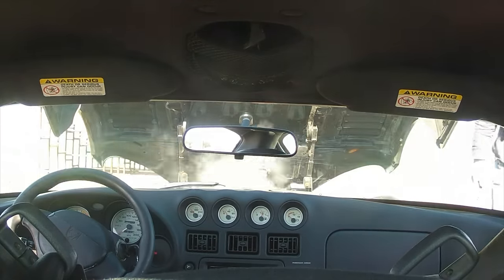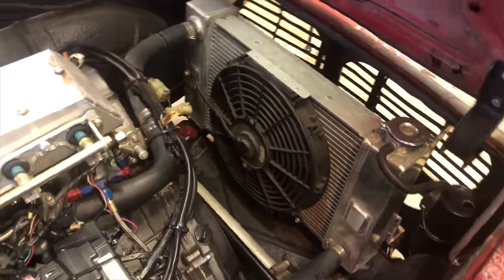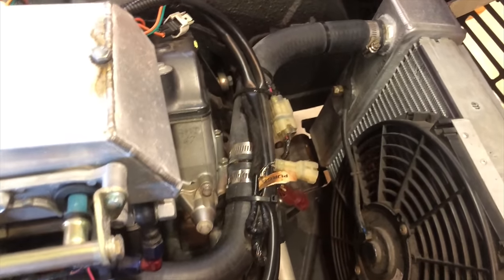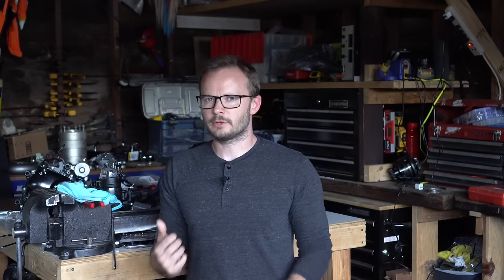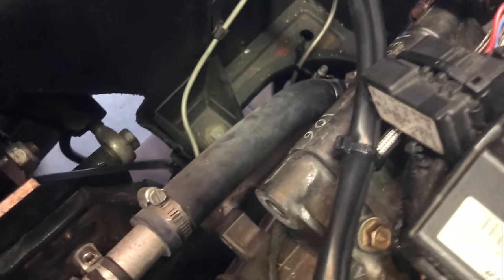For cooling, you can use the radiator that came with the car — super easy — or the radiator from the motorcycle, which is more difficult. I took a third option: I bought the widest radiator that would fit in the car, cut the bottom off, and welded caps on it for maximum height, essentially filling the whole frontal area with a big aluminum radiator. It's more cooling than needed, but that's better than not enough. For plumbing, go to your local auto parts store, explain what you're doing, and look through their hoses in the back to find the diameters and bends you need. Get some unions and clamps and piece it together, mounting the hose to the body every eight inches or so.